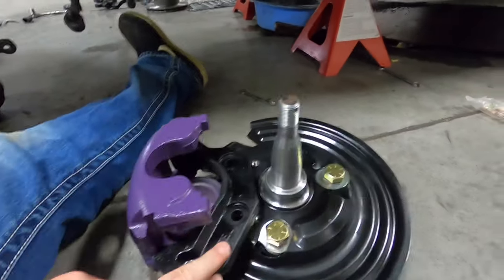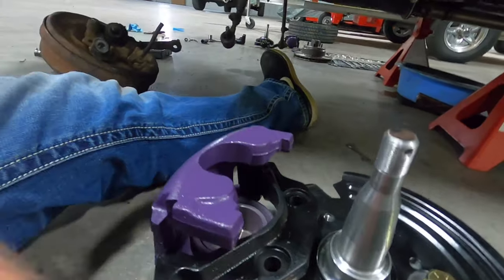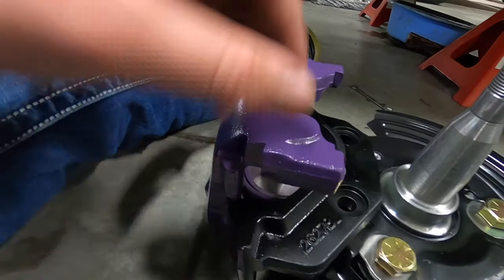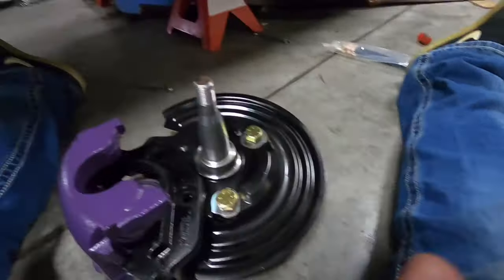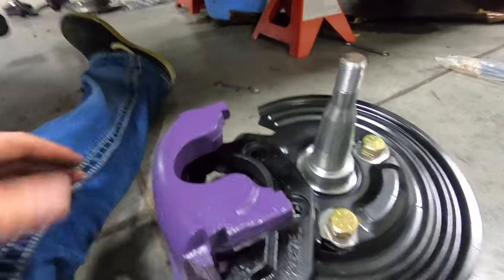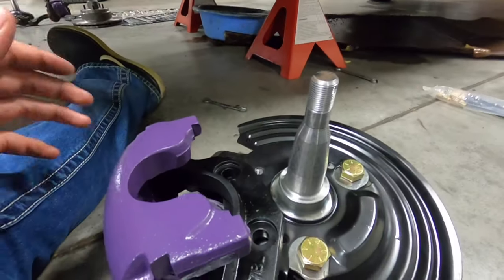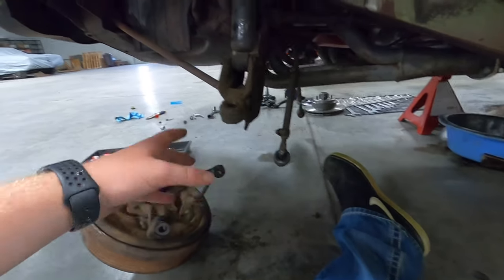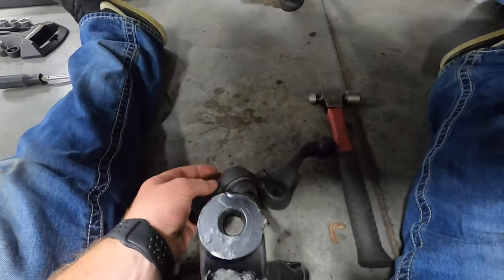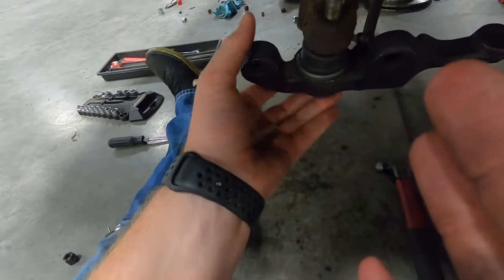At the moment, this is what I'm working with. I think this is how it goes — we got the bottom ball joint right here with these bolts, and then the dust shield and whatever this is going onto the caliper. The rotor is going to fit right in between there, obviously. We do need to put the bearings in so we can fit it on there. I think I'm going to go ahead and get the spindle on with the tie rod and the bottom ball joint first — start off with putting the bottom ball joint in and bolting that up, and then bolting the spindle onto the ball joint.